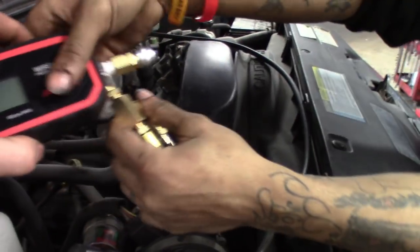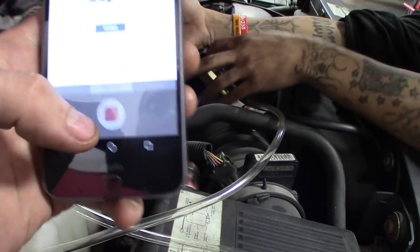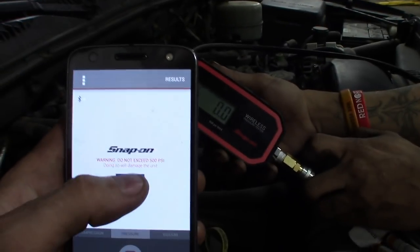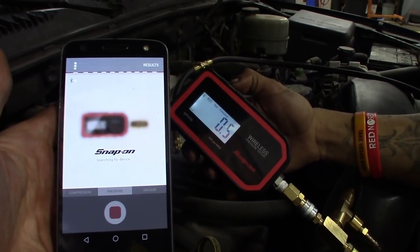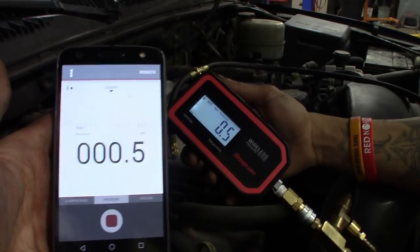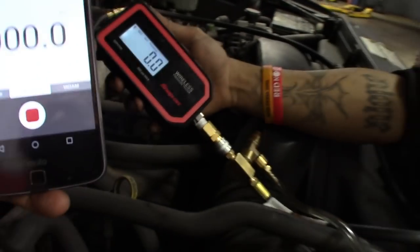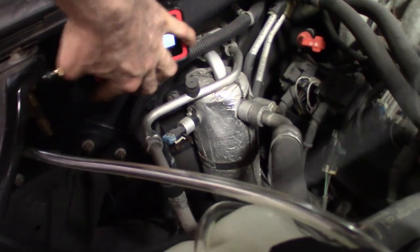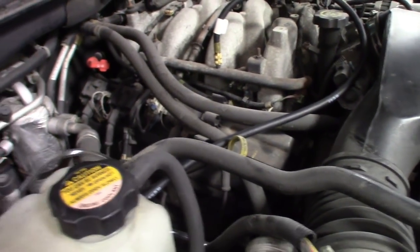Alright guys, we got Adam hooking everything up to the fuel rail. Since this is wireless, I'll show you guys how to set this up and how to link it to your phone. I'm just going to stick it to the side there while we test drive — be able to shut the hood, not have to worry about any hoses sticking out. Fire off the app, hit connect — sometimes you got to hit the Bluetooth button. There it goes. We got it hooked up, you can see the little Bluetooth icon lights up and we got the graphing on there. Route the sensor away from any moving parts or anything hot — it's got a nice strong magnet on there. Route the vacuum hose so nothing gets pinched. Alright Adam, go ahead and shut the hood, we'll take this thing for a ride.